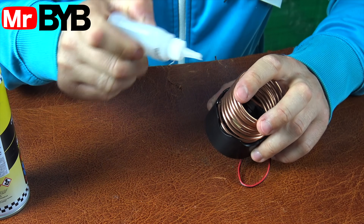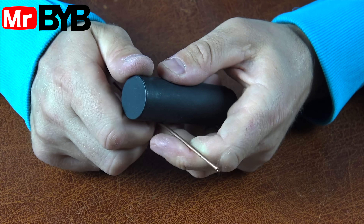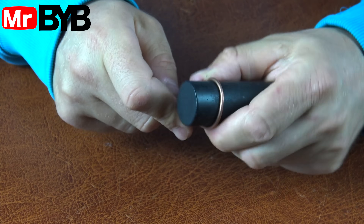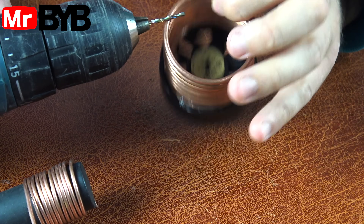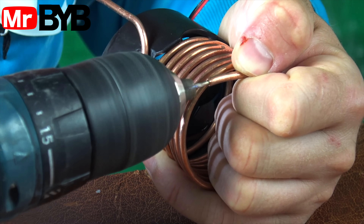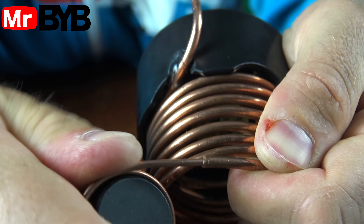We're making another neat spiral from a thin capillary tube. This tiny tube plays a very important role — it acts as a throttling device. The capillary tube creates resistance in the refrigerant flow. When the refrigerant passes through it, the pressure drops sharply, causing the liquid to evaporate quickly and turn into cold gas. This is where the real cooling begins. Without the capillary tube, the whole system wouldn't work efficiently.